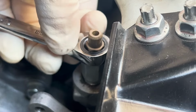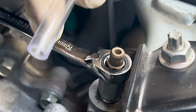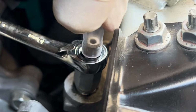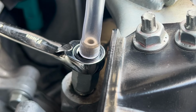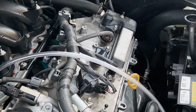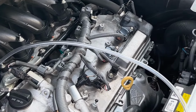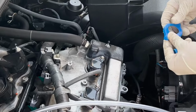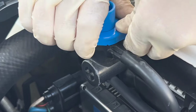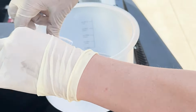Let's get that going first. Okay. Quarter-inch ID clear hose. It is a snug fit. Set that up. And you're gonna use one of these plastic funnel deals for the setup for the bleeding. I'll show you how that goes. Set that up. This hose is gonna go right in here.